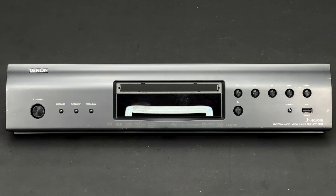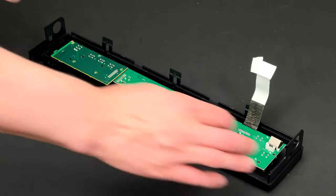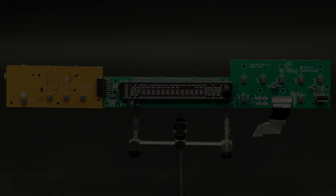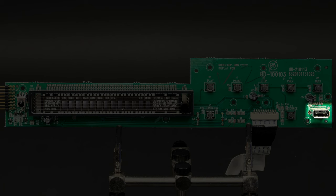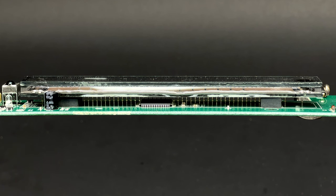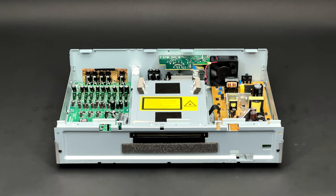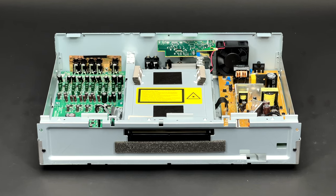This panel is made purely from plastic, which is rather disappointing. On the front PCB you can see 11 micro switches, USB socket, IR receiver, and vacuum fluorescent display. The PT6302, the driver chip that controls the vacuum display, is hiding right behind it. Even though the front panel is made of plastic, this unit is fully shielded by a chassis and top cover which are both made of steel.